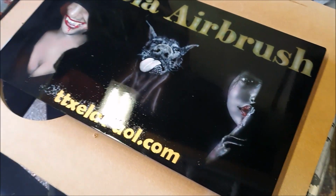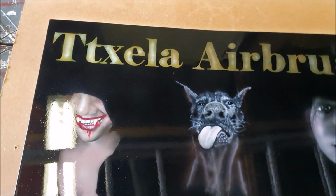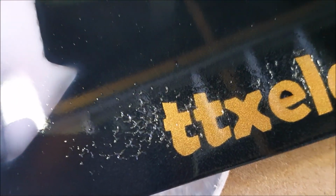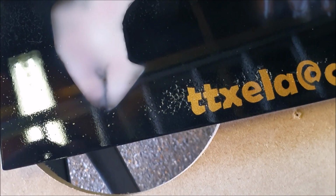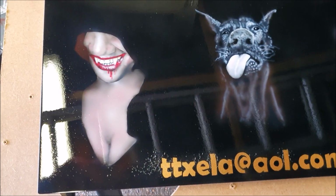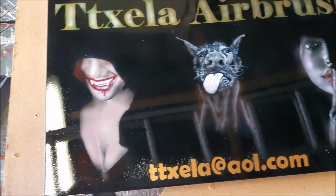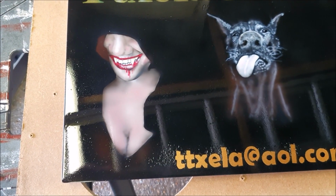Well, it's had a good 10 minutes to dry, and it's not looking too bad for the most part, but look at this. Oh dear, we have got a little bit of pickling and wrinkling going on there, for definite. So we might be able to get rid of it. We might sand that off, or it might shrink back. That seemed to be what happened last time. It shrank back a little bit. Hopefully it doesn't spread. Yeah, this clear coating is not an easy business. We're just going to have to try and deal with that later on.